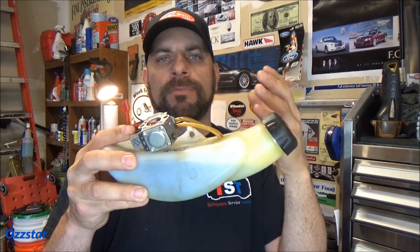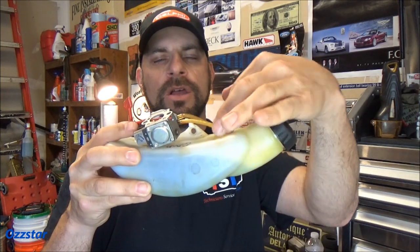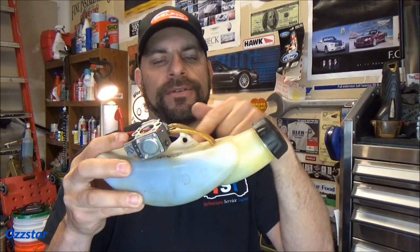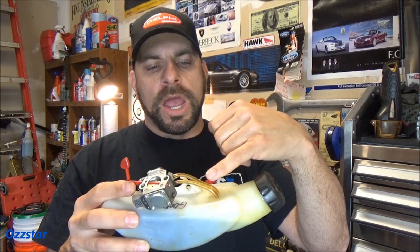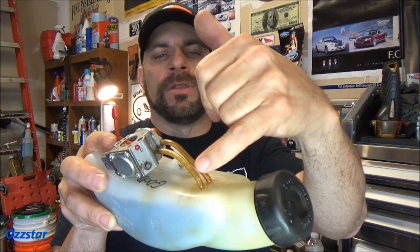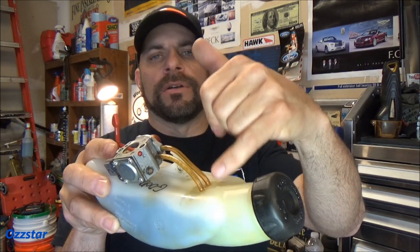Some people think you need to replace the entire tank — you got to buy the part, the entire tank with the filter in it. There is a filter down in here. I'm going to show you how you don't need that. You can buy the fuel hose online — I'll leave links to all that stuff — but I do want to show you a tip, because a lot of times even if you go down to Depot or Lowe's and buy new fuel line, the diameter is going to be bigger than the hole that's there. So let me show you what I do.